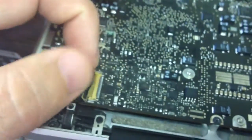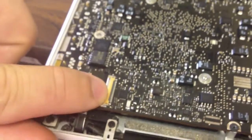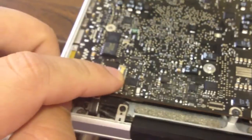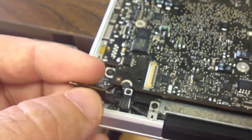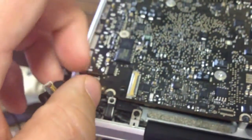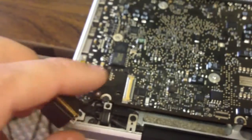What you're seeing is a piece of this plastic gets hot and will melt. With an LED screen, this port supplies both signal and power. So the power pins are getting hot, causing the plastic here to weaken, or somebody's pulling on this and ripping the plastic when plugging it in and unplugging it. This causes the metal bar to touch one of these pins and short the system out. It fries this chip, which goes directly to the LED power, or it'll fry one of these pins on here. Fairly common.